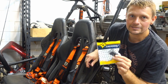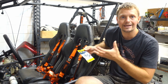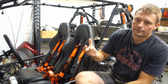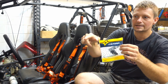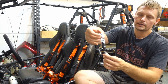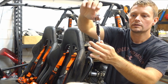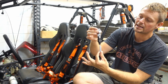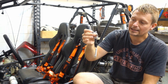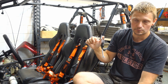Now what the flat shift switch does is this switch is just merely a grounding switch. It can be either a brake switch or a clutch switch. Usually when you're doing this on an automotive application, you will have a little brake switch that has a plunger that depresses when you press the brake. Unlike the plunger style of switch that's not weatherproof, this is more of a motorcycle or ATV style switch that instead of plunging, the switch is activated when this is pulled. Not only is it an extension so I can hook this onto the clutch pedal and it pulls it, but in its resting state this is open, which is exactly how this needs to function for our MegaSquirt 3.